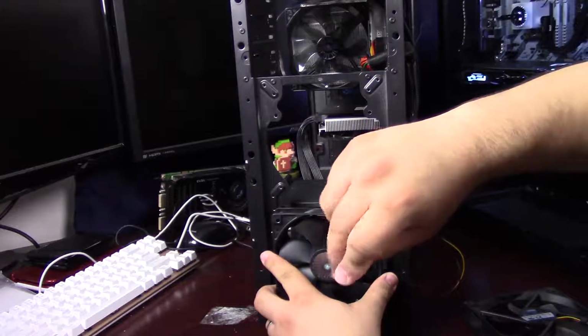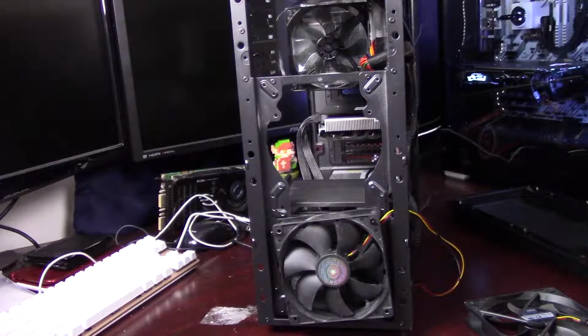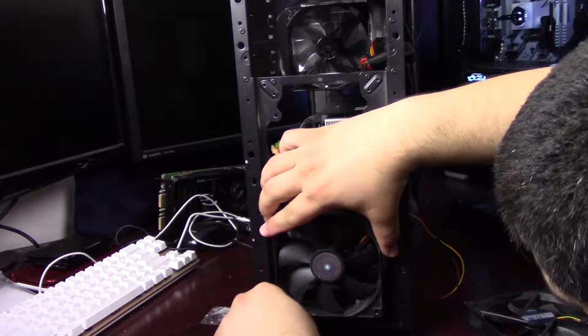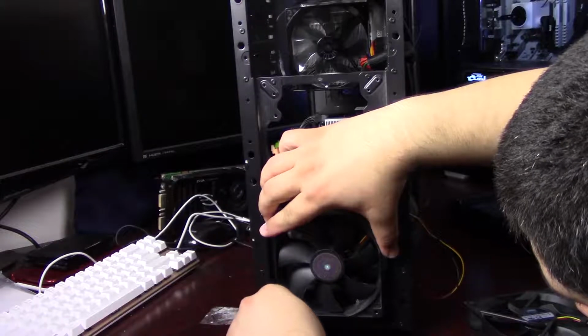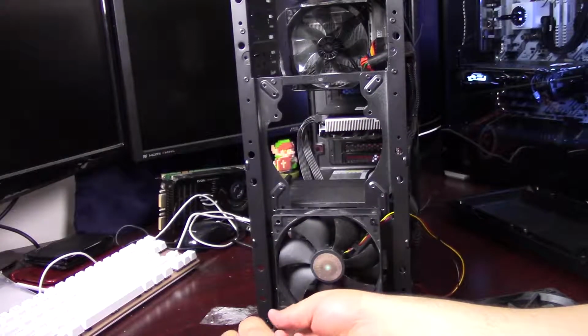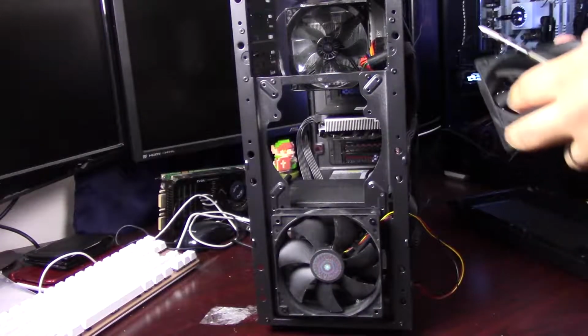And you'll see to the right there's a little cable management hole there for the cables for the fans to go through. So I'm going to rotate the fans in an orientation so that the power cable for them naturally goes towards that hole. So got bottom left and top right for that fan. So for this fan, I will do bottom right and top left.